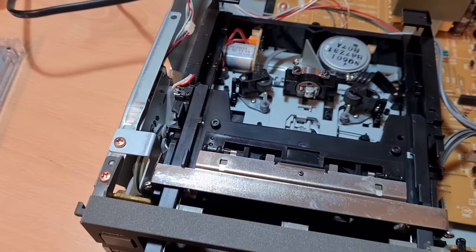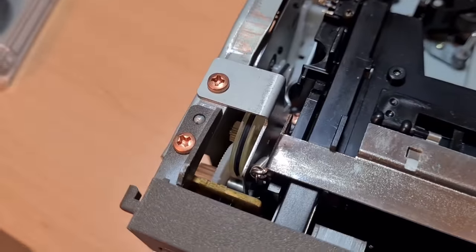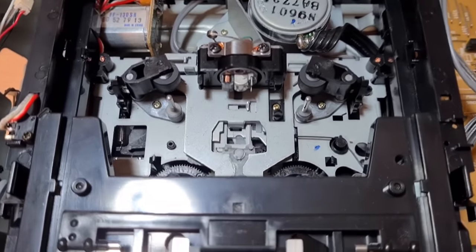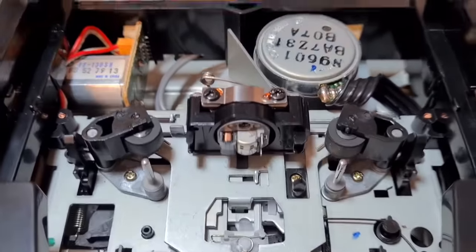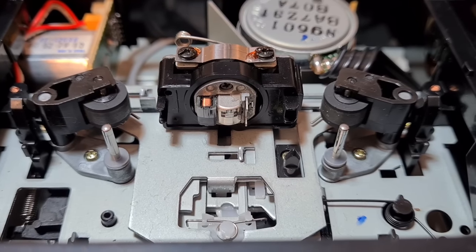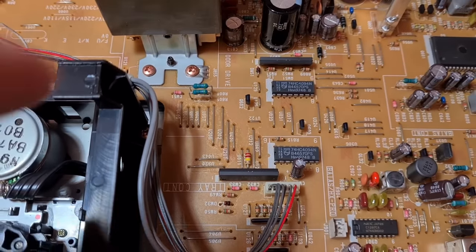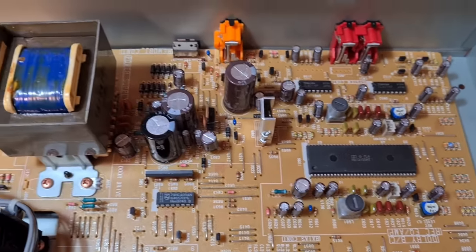Now the lid's off we can have a look at what's actually driving this. The front panel is on a motor and belt on the left hand side as we look at the front - replace that belt, it looks all right. The transport itself is fairly complicated - we have what looks like dual capstan, dual pinch roller, auto reverse, which is in immaculate condition. This is really clean. We've got a pretty standard cassette board all along through the unit. The command board elements are labeled: door drive, tray control. There's a nice big Dolby chip in the corner.